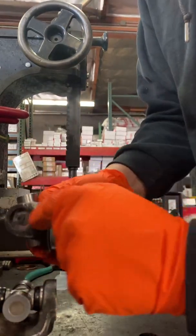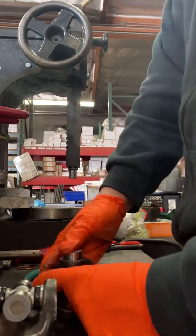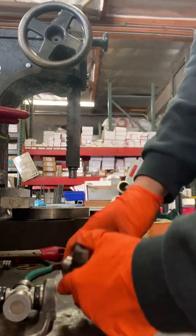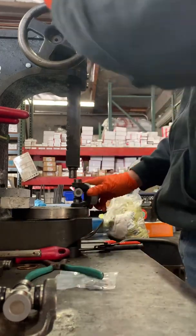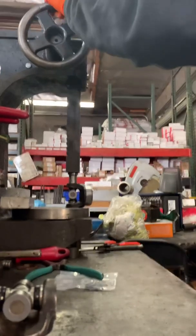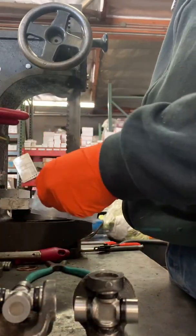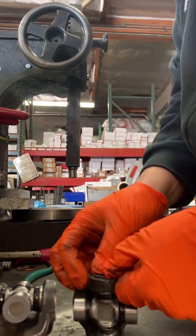Once it's in, you'll see that it's right in the groove. Then put your other side on, get the other cap on. Center it on the trunnion, put it in, arbor press it down, put the bottoms out. Take the other clip and put it in.